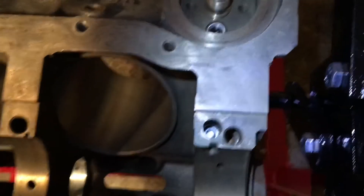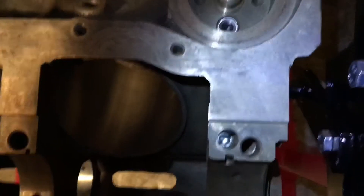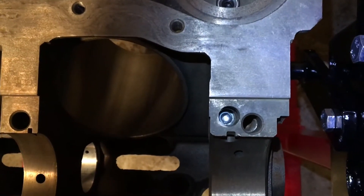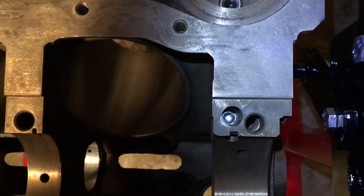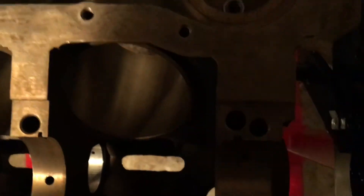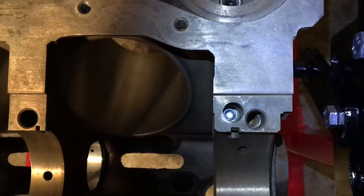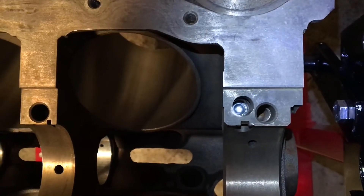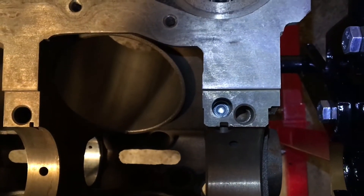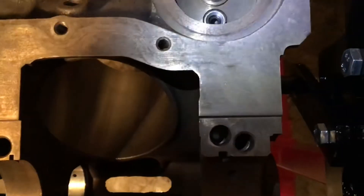I drove it in — it was some force, but it didn't take a lot. The pressure difference across that plug is going to be just the difference across your filter, so it's not holding a lot of pressure back. It's going to have just about the same oil pressure on both sides of the plug, so there's not going to be a lot of force trying to push that plug out. The plug is going to hold just fine and will divert oil over to your oil filter.